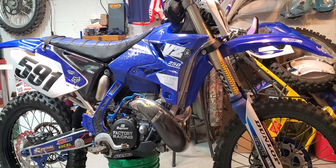This thing is running great and looking great. Also forgot to mention — I added a 13-ounce flywheel weight from Mac Daddy Racing on eBay. It's pretty nice because you can be in third gear going about six miles an hour and it won't stall out on you, which is helpful when riding in the woods.